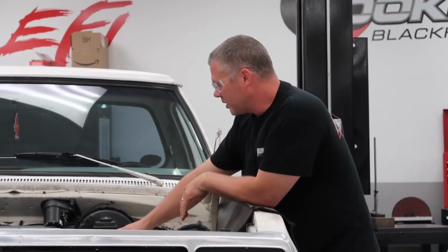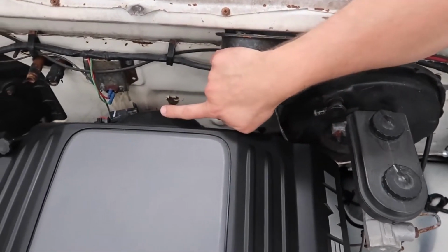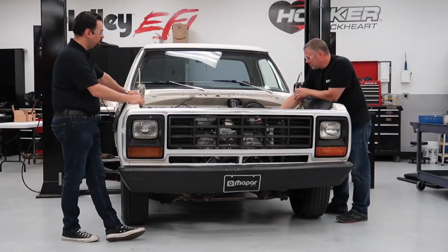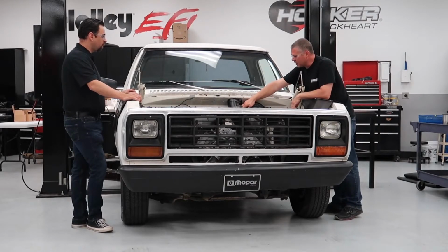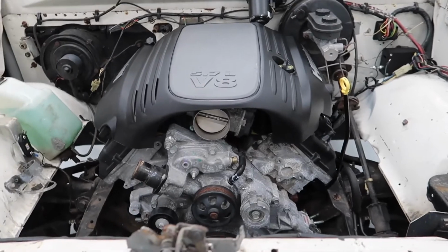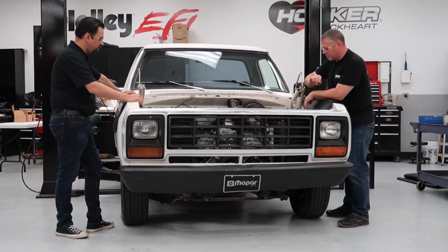It gives you extra clearance around your brake booster against the firewall, and you can get all of your stock accessories and everything in there as far as clearance. You can see the engine cover clears your brake booster, your master cylinder, your firewall. You've still got your hard lines for the coolant tubes that run underneath the air intake manifold, so you can still use that. The variable runner length system, you can still use that here. It does not crash into your firewall, so you don't have to delete that. We think that's a pretty nice feature.